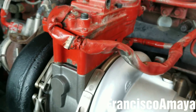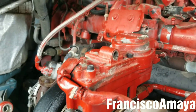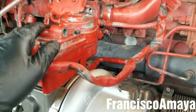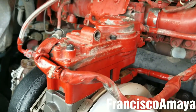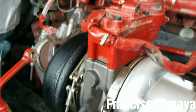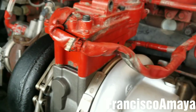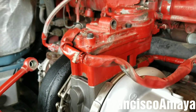If the actuator installation and calibration doesn't pass, you'll need to remove the actuator and replace it with a new one. If you replace it with a new one and calibration still doesn't pass, that means there's something wrong with the turbo itself. I just wanted to mention that in case you're replacing the turbo repeatedly and still can't get calibration to pass.